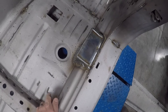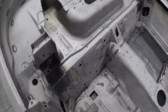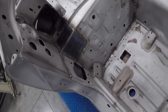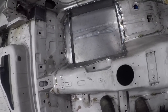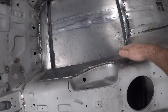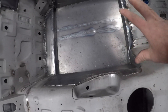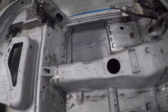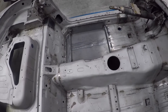In the old days, you'll see people put plates into the floor, but these floors are really light duty, so there's really no reason to be installing your plates into the floor. Same thing back here on the rear shelf — we will not put the plates to the floor, we'll go to this rear shelf which is much, much stronger. You can also see that the floor drop has been installed. This makes the floor much stronger and extends the tunnel slightly to give us more room for a proper seat and a nice flat base to mount a really quality race seat to. This is a big part of doing it properly and making sure that the driver stays safe while bolted into the car.